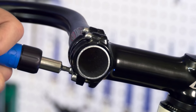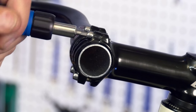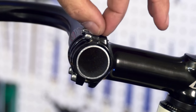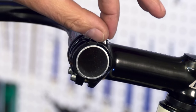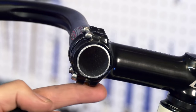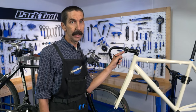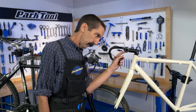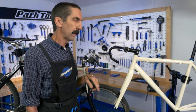Even if we use the manufacturer's torque specifications, we have a problem. The tension of our bolt is actually pinching and touching here — it's not transmitting the load to hold the handlebar tight. But that's just one of the problems. The other one: remember, the axis of the thread should be square to the head, and now it's not, and that can bend the head. Worse than that, every time you turn it around, you're still bending the head. So let's fix it.